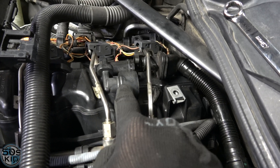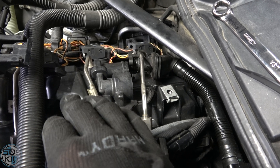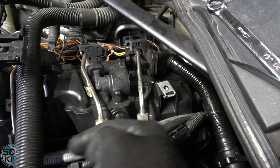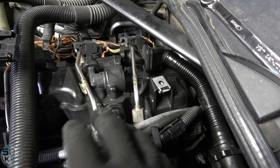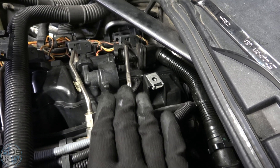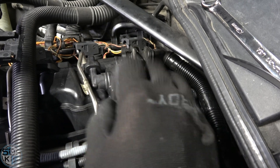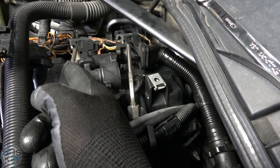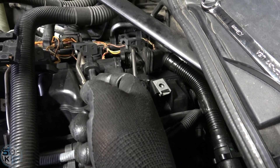On the low side, whenever the engine is idling and vacuum is high in the intake manifold, the valve opens and sucks blow-by vapors through a metered orifice — out here, through here, and back into the intake manifold to get burned off. But when you're accelerating, vacuum is low and boost pressure is high, so you want this check valve to close off. You don't want boost pressure leaking back into the valve cover, because that would be really bad.